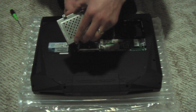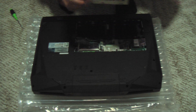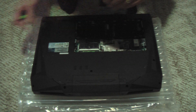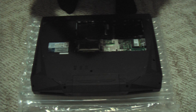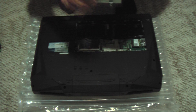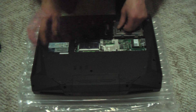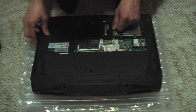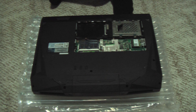Remove the screws, flip your bracket 180, and now since I'm installing it on the left slot I'm going to line up the holes with the L holes and then fasten that in. Once we flip that bracket 180 into the L's, we're able to install it in the left slot. These little ears will go into these little plastic pieces. The top of this bracket says 'connector L' now on this end, so we know we've got it right. This little tab lets you pull it into place, and now I'm going to re-fasten the hard drive.